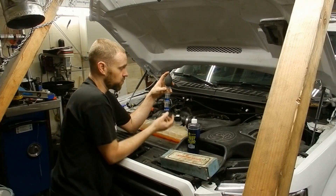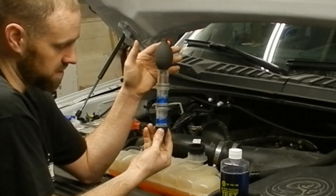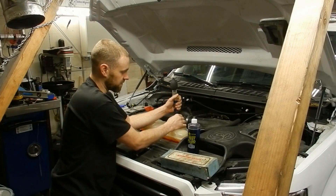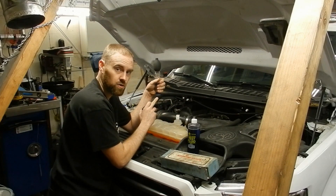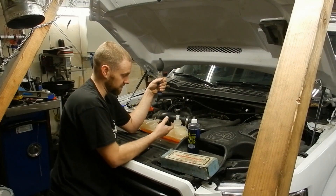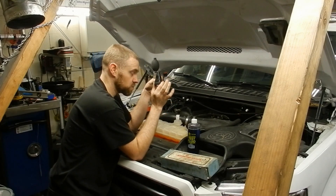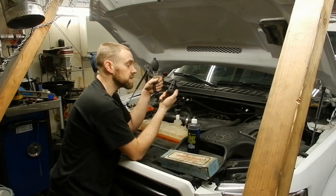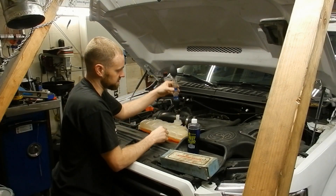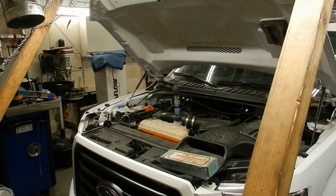This little bulb has a one-way valve — a check bulb — so it can only pull air through when you squeeze it. Squeeze it and it pulls gas through the chambers. Now this cap doesn't fit this particular design cone, and the one linked below may not fit every vehicle either. You might have to find a way to adapt it. This cone is from one of my vacuum cooling system kits and it fits really well — I can shove it over the top of the filler neck for a nice tight seal and then into the tester.